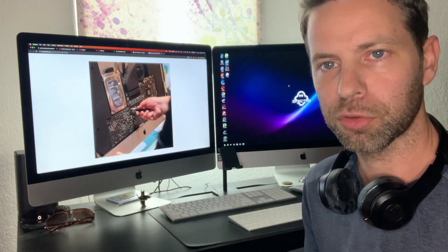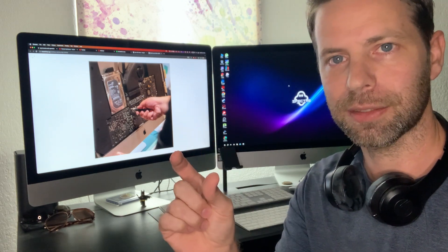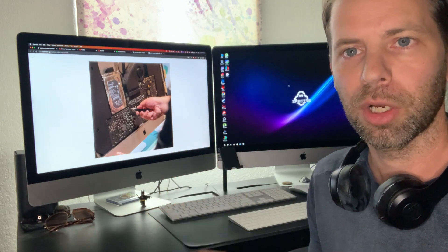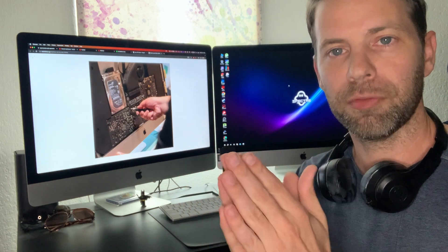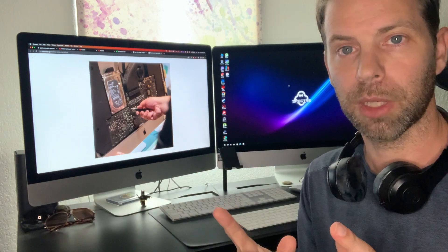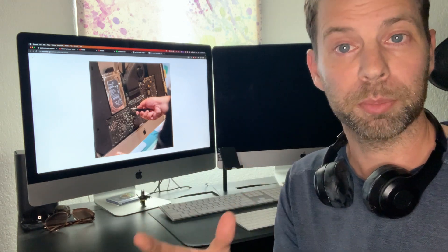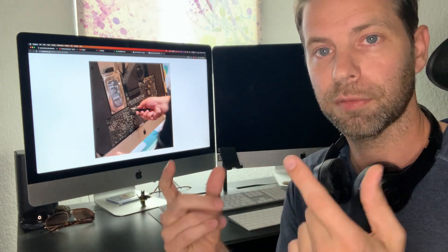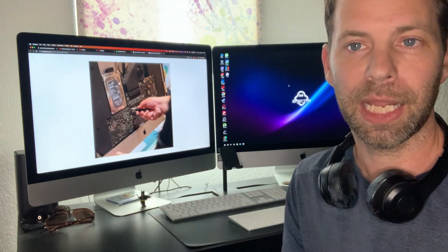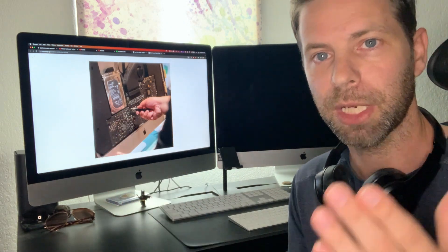This one had a fusion drive, and if you know anything about fusion drives, they are notoriously bad and they fail. That's because you've got an SSD which is super lightning fast constantly writing to an old platter hard drive. If you have a fusion drive you can actually split it — boot from a thumb drive with Monterey or Ventura, open terminal, and separate the fusion drive into two separate drives. You're left with a 120 gigabyte SSD and a three terabyte storage drive, so I was using the three terabyte for storage with my OS on the 120.